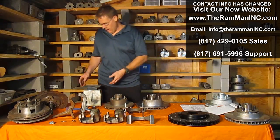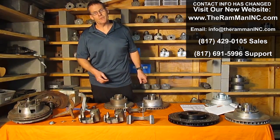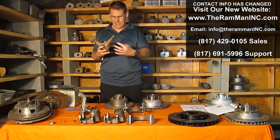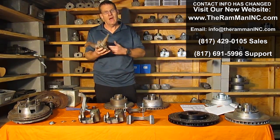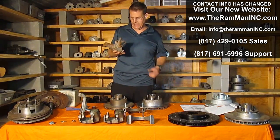All right friends, starting off at the beginning, this brake's on a MOPAR. There are several companies and outfits that have some disc brake kits on the market that use a plate type system designed to bolt on to these drum brake spindles. For several different reasons, this is a bad idea.